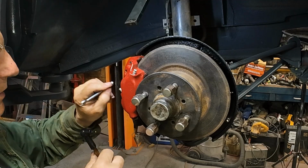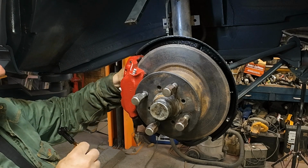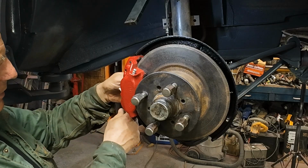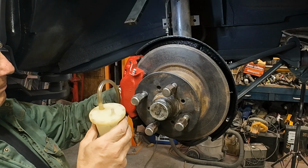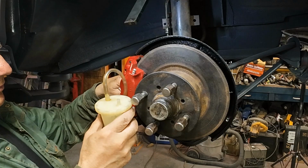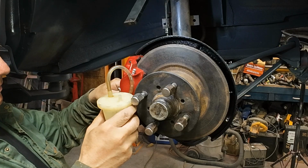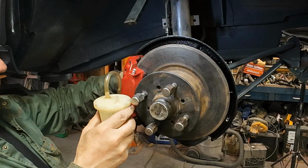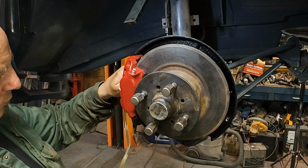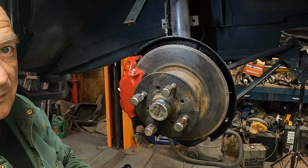Same thing, you got to put the wrench on first. And this on top of it. And there goes the air and the bubbles. A couple of bubbles coming through that one, right? How come? There, it's clear now. Because it's a different line. Okay, that's pretty good. Now one more to do over on the other side.